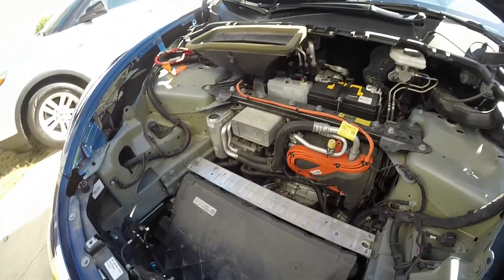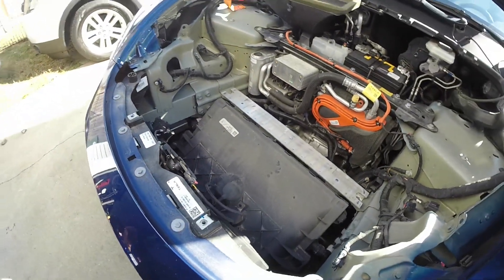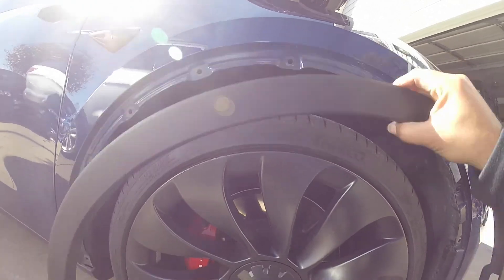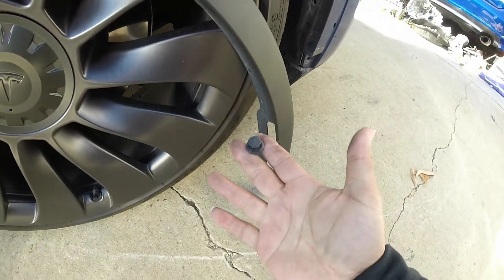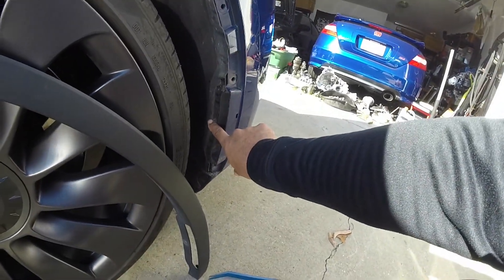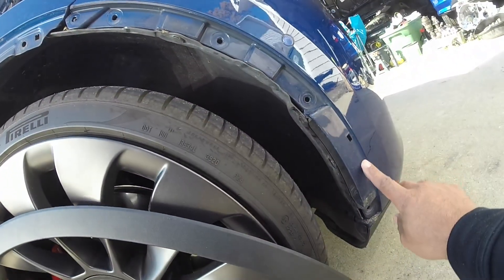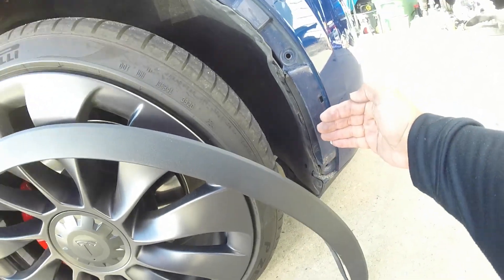We're going to move ahead and remove the front bumper. The first item that's different is that this Model Y has a veneer over the fender. The way we found to remove it was to remove this clip right here, then pop all the clips all the way out. You have to be careful in this corner because there are pieces that go in there — when you remove the front you need to pull it out this way, then pop all the clips.